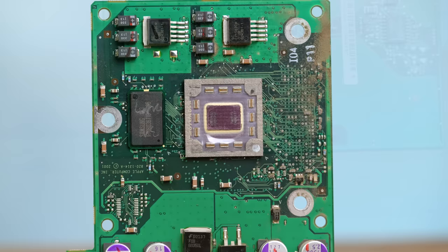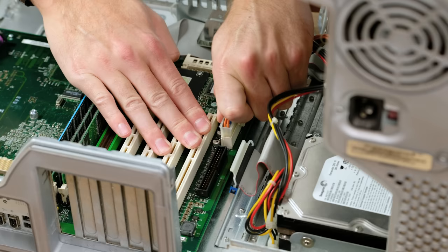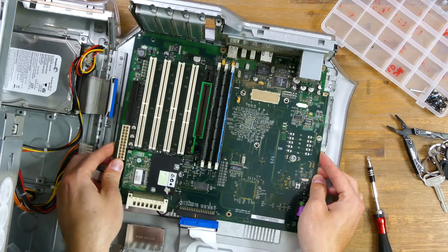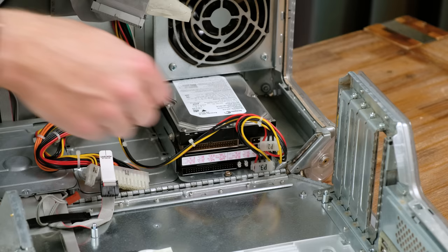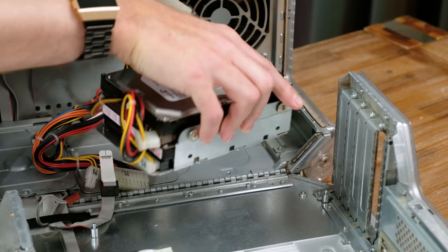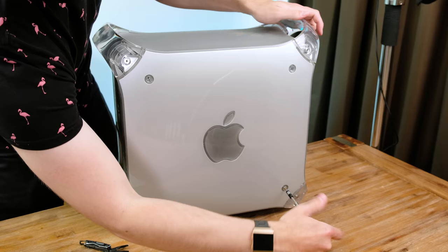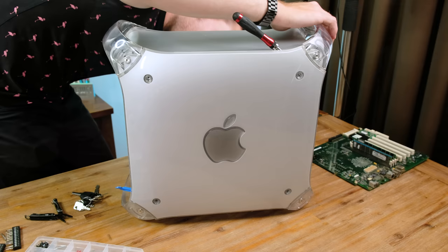You'd have more luck finding one that's already in an existing G4 machine, and if you're lucky you'll get it for a good price if the seller doesn't advertise it correctly. Continuing the teardown, I unplugged every connector attached to the logic board, then removed several standoff screws that held the processor card in place. After all the other Phillips screws were off, the board slid back and I could lift it out of the chassis. A second hard drive was installed at some point alongside the original 60GB one; these both connect using the same IDE interface cable. I'm not sure if this has an impact on performance or not. To get the side casing off there are four hex screws, one in each corner.